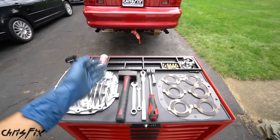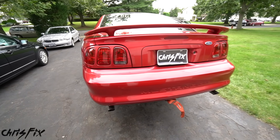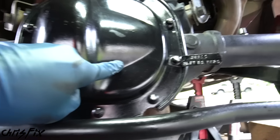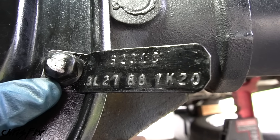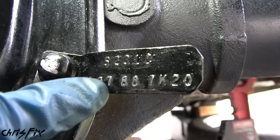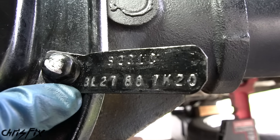Any situation where your tires might slip, a fresh limited slip differential is going to give you more traction. Now, how do you know if your car has a limited slip differential? One way to tell is to go under the car, find the rear differential, and look for a tag. And if you have a tag like this, it gives you a lot of information. So we have 3.27 gears in here and this is an 8.8 rear end. In between the 3 and the 27, you can see there's an L — that means it's limited slip.